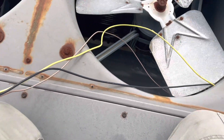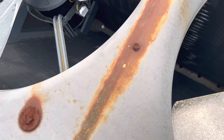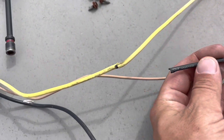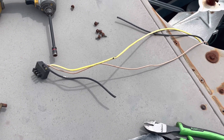So I got the harness pulled out of there. It looks like it chopped the black wire completely in half, and it really did a number on the yellow wire. I'm going to try to get this fixed and rerouted in a way that makes more sense. Instead of coming over top of these fan brackets, I might go underneath of them and fasten them so they're well below the fan blades so we don't have an issue of this happening again. We got these splice connectors and some zip ties, and we're going to repair both wires. I think these are our only two damaged parts, so I'm going to cut the bad parts out and splice them together.